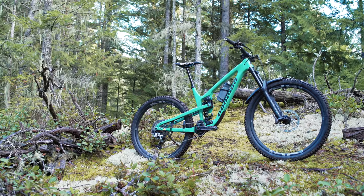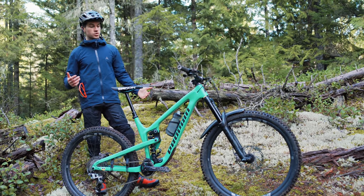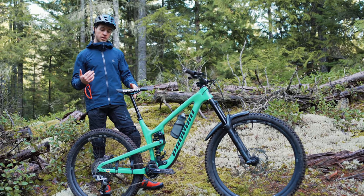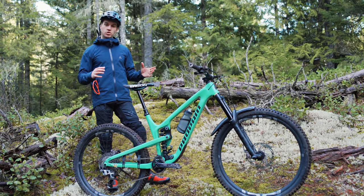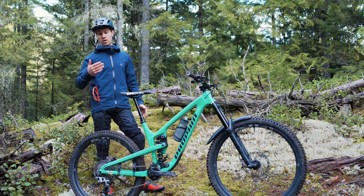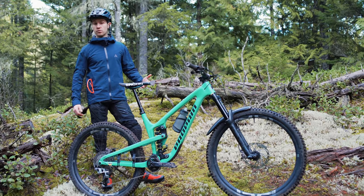The 29 is a bit longer than the 27.5, and I've decided to mullet the bike, so it has a 27.5 rear wheel. I was able to do that by putting a longer 180mm fork on the front, which makes the bike a bit slacker and the seat tube angle a bit slacker. But even so, the position for pedaling is still very comfortable and efficient because originally the seat tube is quite steep. You have to keep in mind the bottom bracket drops a little bit, but I run my suspension stiffer than most people, so my position at sag is actually higher. I also have the same bike with the exact same build in a 174 and 29-inch wheel version that I'll be reviewing in the future.